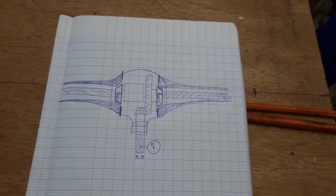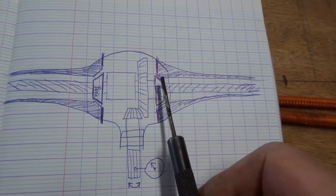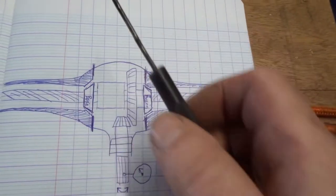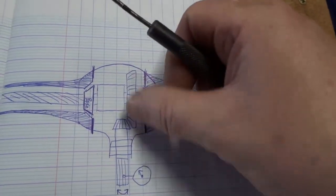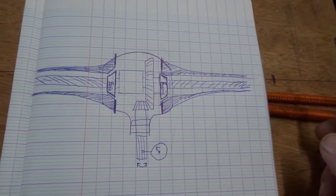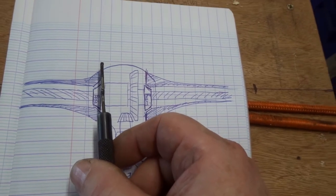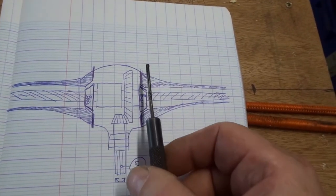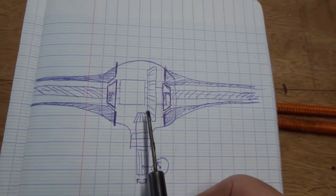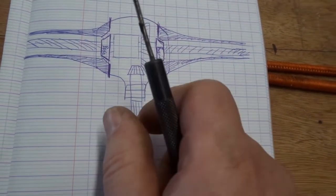There are different ways of doing this but the main things are: first you've got to get the side-to-side play just taken out, and the way you do that is with the shims. You put different gaskets in until there's no lateral movement and you can just spin the crown wheel by putting your hand in and flicking it, or grabbing the ends of the axles and turning them the same way. There should be slight drag but no lateral movement. Once you've done that, remember what shims you've got on each side and add them together - make a note of that total.